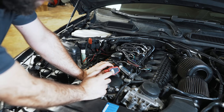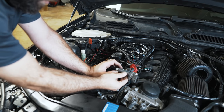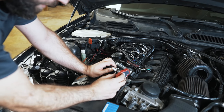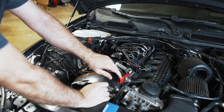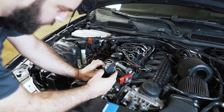You can picture it where you have a similar coil body but not much area to store spark energy. The Audi coil is similar - it has a little bit of an area - but mostly it's going to be taking power from an external source, so it doesn't need to draw a lot of amperage from the ECU that drives it.